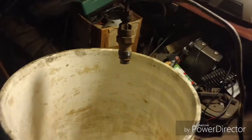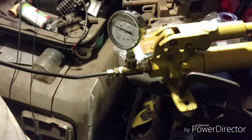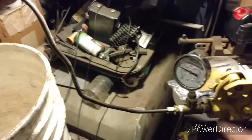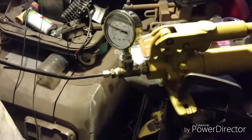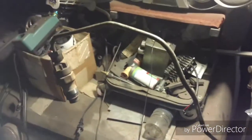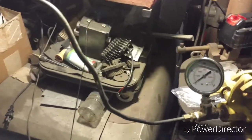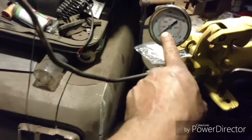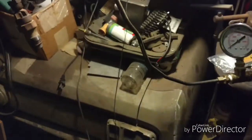But this is better than what I have been using. The injector testers they have on eBay are really purpose-built, but I think I've managed to cobble this one together for like $13 in fittings, and the pressure gauge is like $10 or $15. From what I see on some videos online for later model injectors — like Ford's HEUI type stuff — once you pump them up they'll probably shoot at around 2,500 psi for a 6.2 diesel.